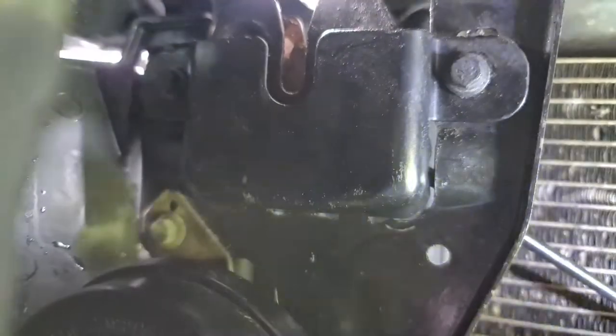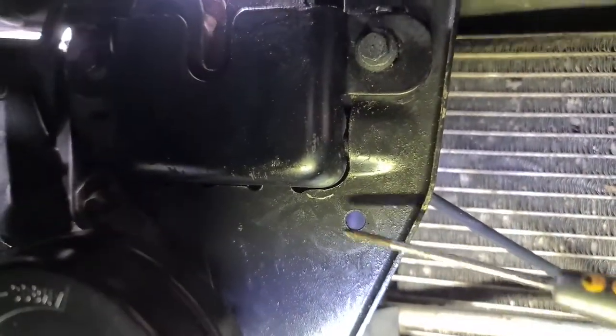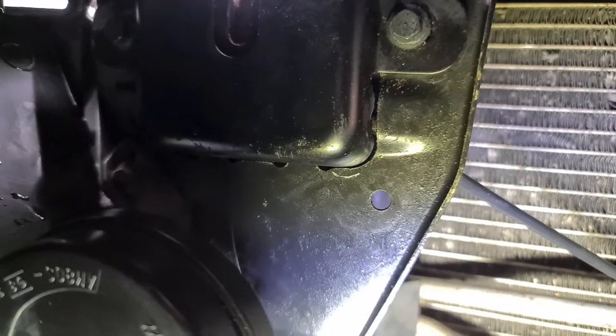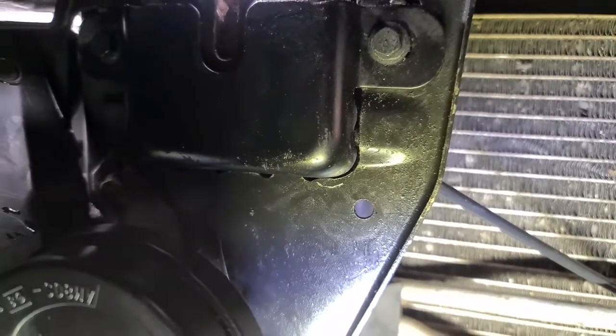Same that side. Once the shield is removed by those two 8mm bolts, it's exactly the same — just a mirror. That plastic shield comes off, the cables detach, there's a little lever you can slide which releases the bonnet catch, and away you go. Hopefully that's helpful for anybody who may ever have a similar situation.